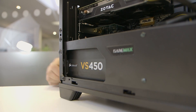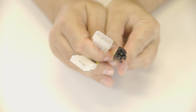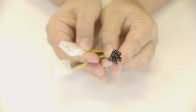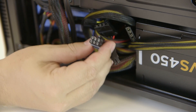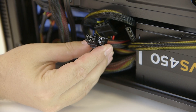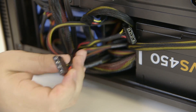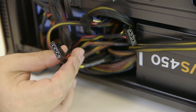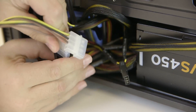You also need to make sure you've got the right power cables coming out of your power supply. And if you don't have the right cabling, you can get adapters like these. These will come in most graphics card boxes, so they'll probably come as standard. You need to check if you've got a 6-pin or an 8-pin power connector coming out of your power supply. If you don't have one of those, you can use one of the adapters to plug into the Molex cables — two of those plug in, 6-pin adapter, and that'll go into your new graphics card.